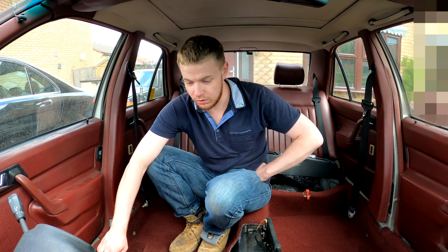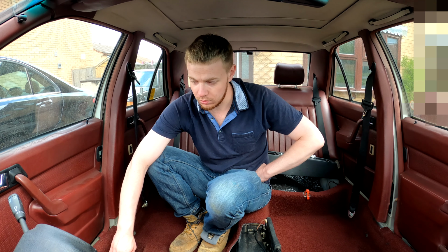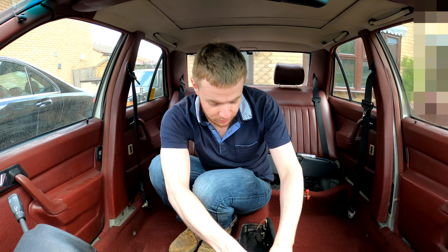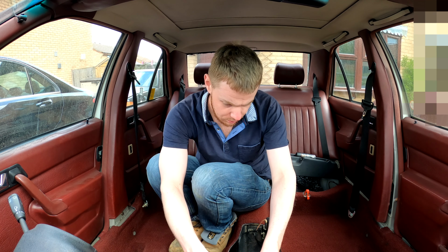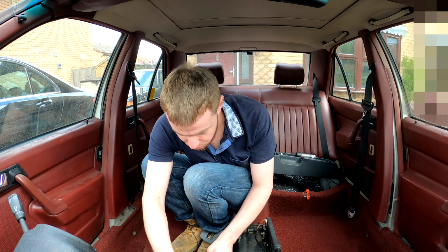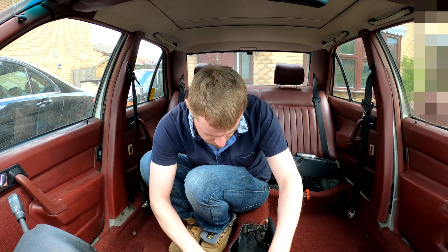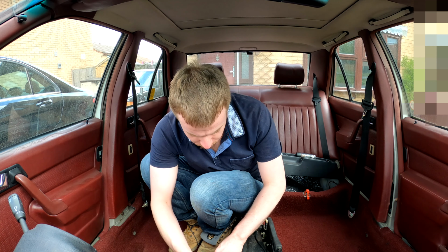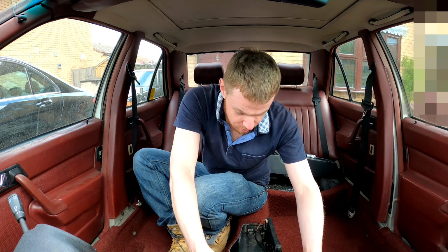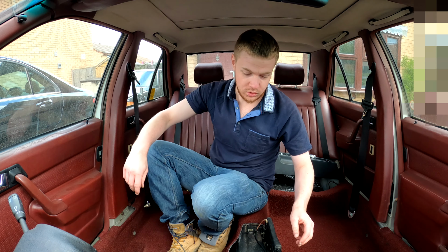Right, so this is technically a left-hand drive wiring loom, so I am basically modifying it to fit this car as we go. The main loom itself will fit. I've got the two seat connectors here and here, which maybe come up a bit more over this way if I could pull them over more. Put on just lovely, like that. Okay, next nut on, and next nut on. They should ideally fit just fine along here, next to the transmission.